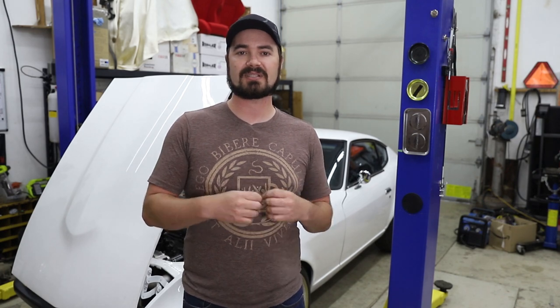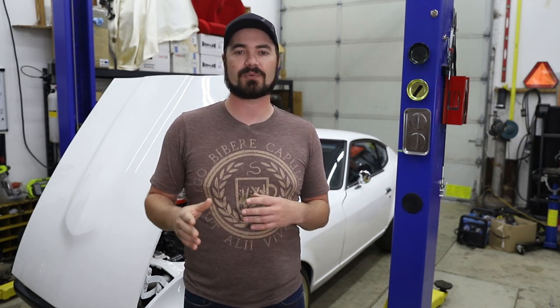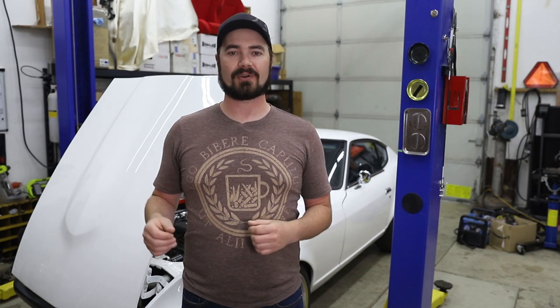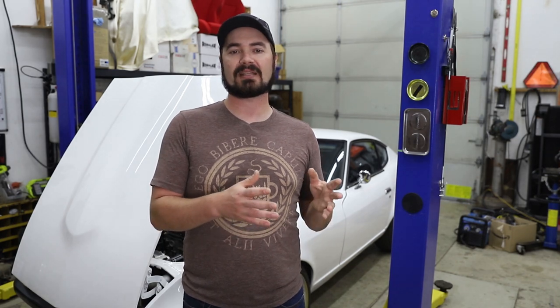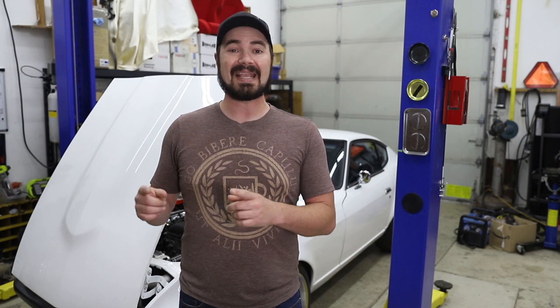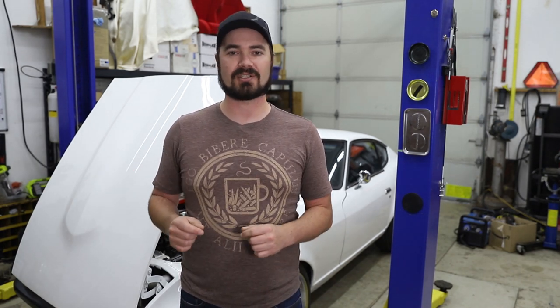Instead of having a fuse simply blow because demand exceeded the 25 amps or whatever of the fuse that was put into the block, if this overloads, I can program it to let it cool down and try again in 30 seconds. I can also tell it to engage an alternate fan. In the same case, I can look at the fuel pressure and decide when to engage a secondary fuel pump, even if I don't have an engine control unit monitoring the engine's vitals. This gives you a lot of power and flexibility and configuration with it.